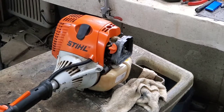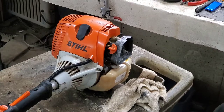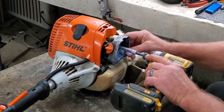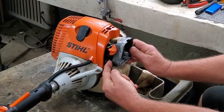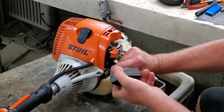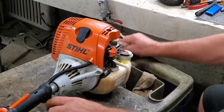Let's see if we can get this carburetor off. A couple of eight millimeters. There's a hose right back here — the breather. Sometimes it pulls off back there. It's your tank breather is what it is.